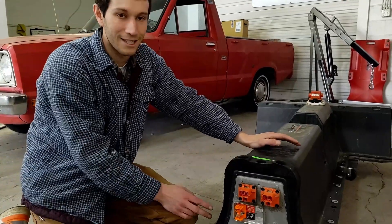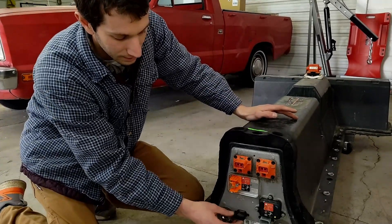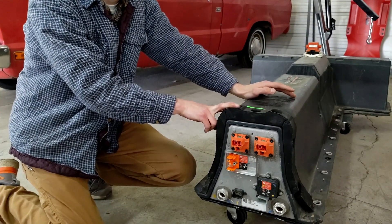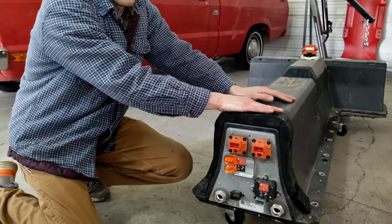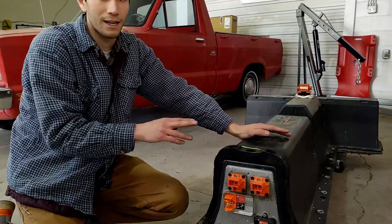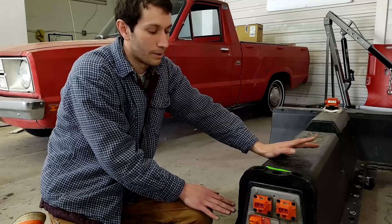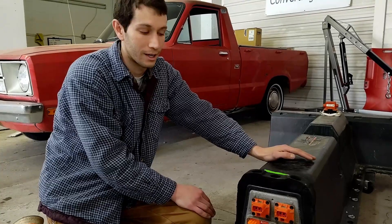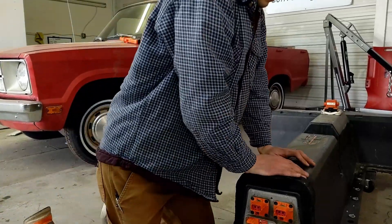But when you buy it, you actually can't check the voltage from right here. I'm still working to see if we can run 12 volts to any of the other plugs to activate the contactors, but I don't think there is — I think they're CAN bus controlled. So I think you can't check if the battery pack is good without tearing it open. One salvage yard said if I took the outside bolts off and checked, they'd still accept it and give me my money back if it was bad. But another salvage yard said they wouldn't — they had someone open it up and fry something inside in the quick time he was checking. So sometimes it's a risk.